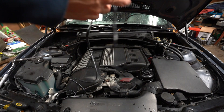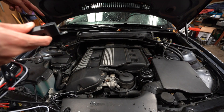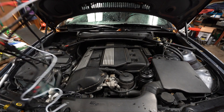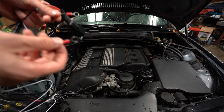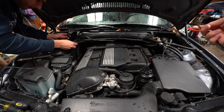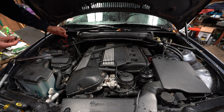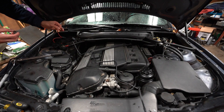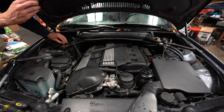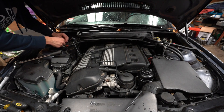Here is the harness. You want to have the actual relay sitting over here where the empty box is — that's where you have your positive and negative terminals that you will attach. Now I'm taking the red positive lead and squishing it in between the power that's coming to the front with this nut, and I believe the nut is a 19 millimeter.